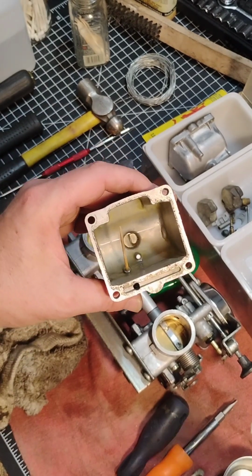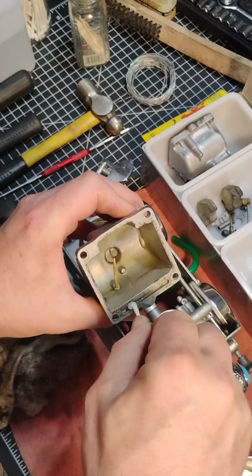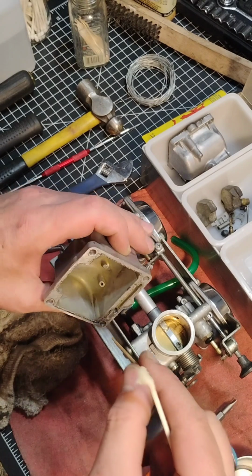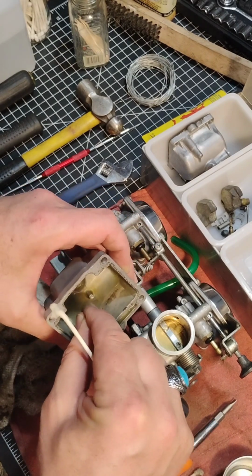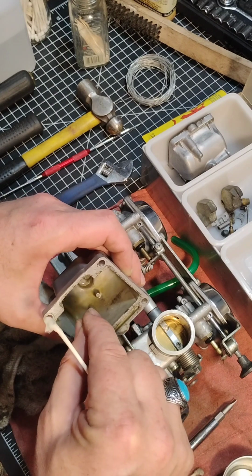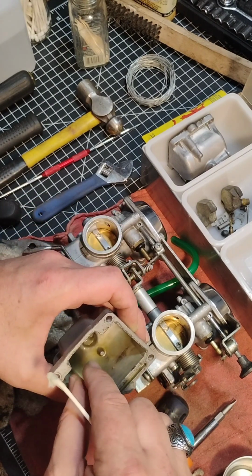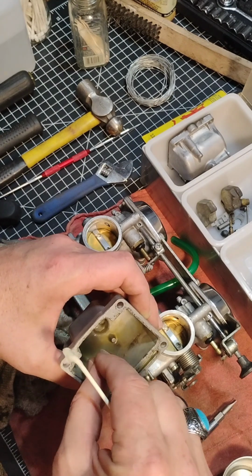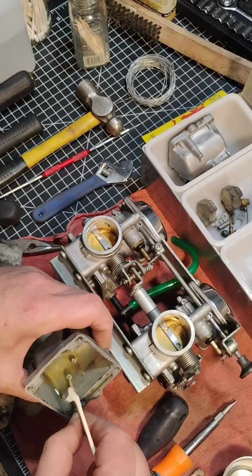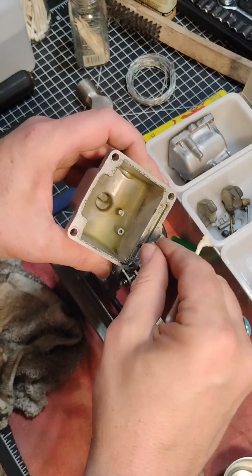So then I was taking a wet Q-tip and running it in there. I had to go through a couple of Q-tips in and out to get this choke hole to flow again, and quite a bit of dirt came out of there. So ultimately, whatever side this was, I'm going to say it was my left side of the machine, your shifting side, your clutch side. This choke wasn't breathing, wasn't flowing. So my motor was only getting choke on the right side.